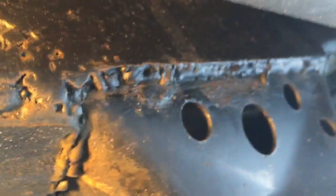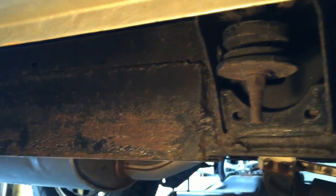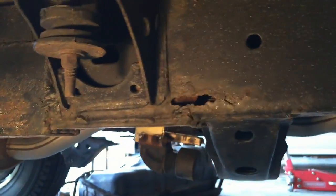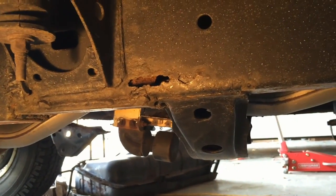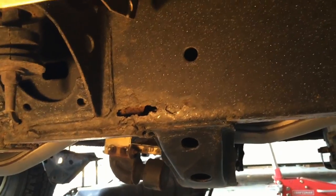I'm going to try to get to the back side so you can see what's happening here. I put a plate — it's hard to see — but there's another plate holding on the anchor to the axle. Back on the muffler side, I still have a little bit more to do right at the crossmember, so I'm going to add another quarter-inch structural steel piece right there.